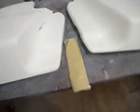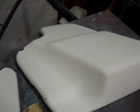Alright, here we are all sanded up in 320. Blended in those rub marks just a little bit. You can see here, like I said, where the old pads are on there. Nice dull finish on any shiny points or anything on it. This is where it all really counts. If you don't scuff sand all over the surface, you can have a lot of trouble with paint adhesion to it. Anytime you're doing this work, always prep these surfaces fully on all the edges and all the curves and bends. Sometimes that's frustrating and tough, but this is where it counts. It's all in the prep.